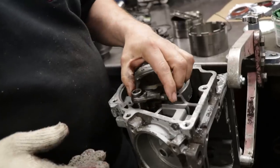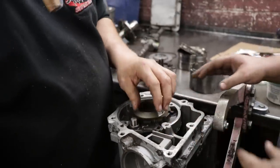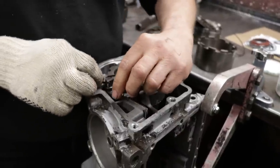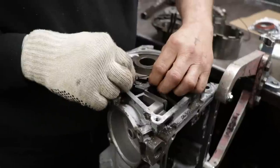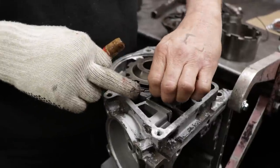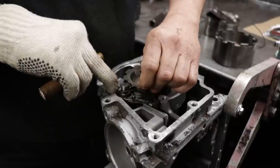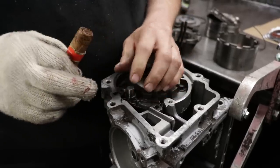Park pawl. So that's the guy, when you slam it in park, it jams in here. When that linkage comes up, it pushes it into the gear. This is like a return spring. Otherwise it would just float. Yeah, and it'd catch every once in a while. Yeah, if this spring was broken or came off, you would hear a ratcheting effect, eh?